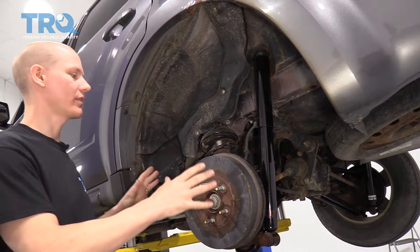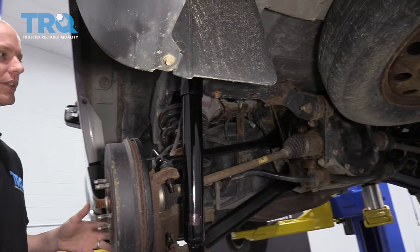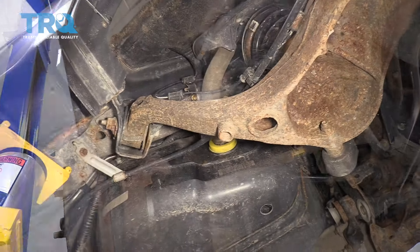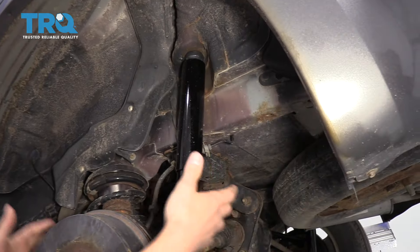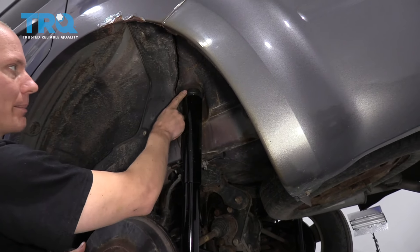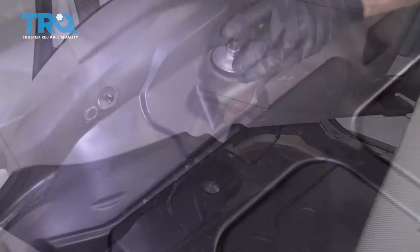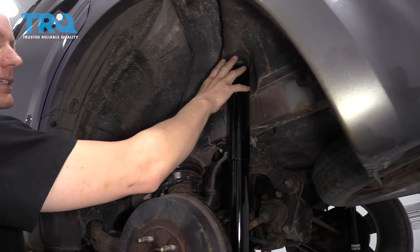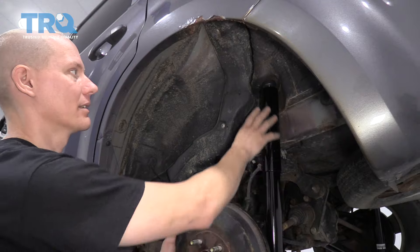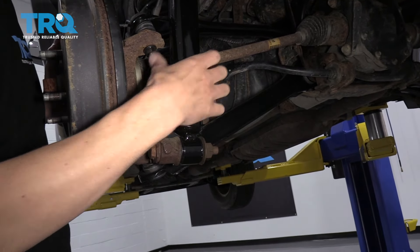In the rear of a car there are a bunch of different styles of suspension. This one has independent rear suspension and it's an all-wheel drive vehicle, so you can see we have an axle, an upper control arm, a lower control arm, a shock, and a trailing arm. To remove the rear shock, up top you usually have one nut on the interior of the car — it's often hidden behind interior plastics, so you'll have to remove some trim to get to it. Sometimes there's an easy access point; other times you have to remove an entire interior panel. Down on the lower side there's usually just one bolt or nut to remove, and then you can pop the shock right off.